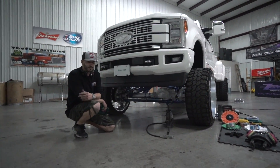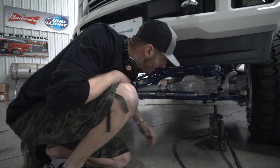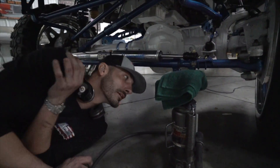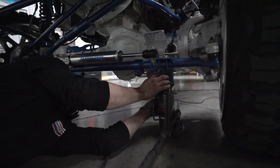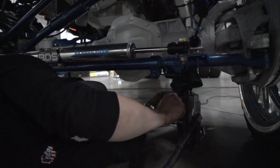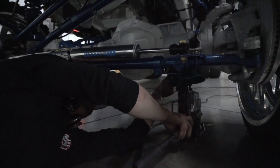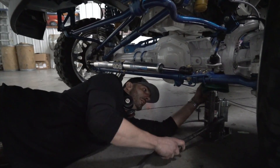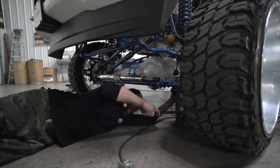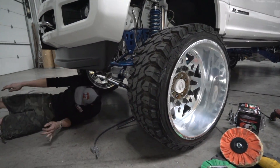We also get a lot of questions as far as jack location — how do we jack it, how do we get the wheel to spin. Just be careful: a lot of these suspensions and everything are powder coated. So always take a rag, fold it over a bunch so it doesn't mess with anything. Get under here, find the right spot — right in the middle, a nice square spot that's even and not anything sensitive. Jack it up, make sure it's right in the middle. You don't want to get too high off the ground, just so you can see a little bit of daylight on the other side. That way you can spin the tire and work freely in your sweet spot.